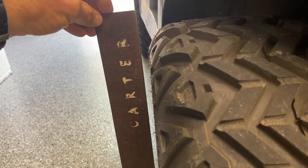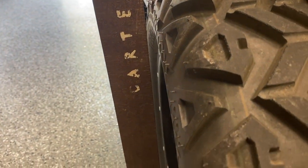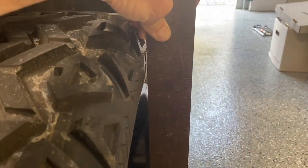What we do is put our square right up against the floor — you can see it touching the bottom of the tire. We are definitely leaning in, so I've got that much room I need to make up. Now let's go look at the other side. Depending on the tire, see the grooves on the knobs? Make sure you're touching the sidewall of the tire and the knob is not pushing it out. I'm a whole lot closer on this side, so the other side is probably my problem for the steering. But we're going to adjust both sides, and my goal is to get that vertical — straight up and down.